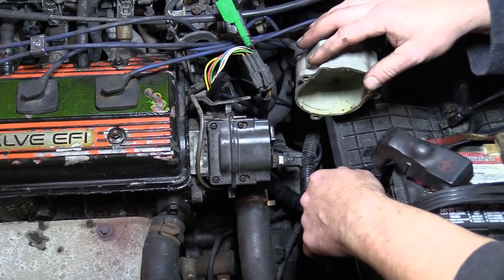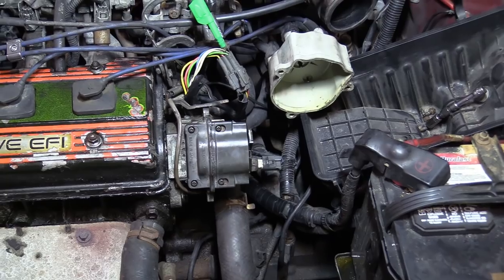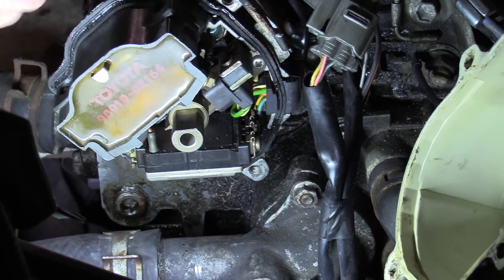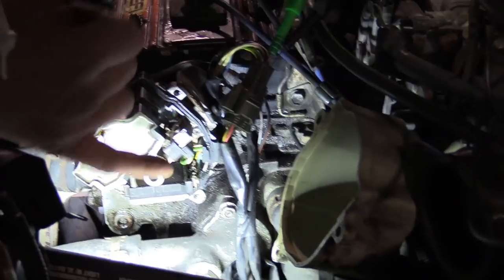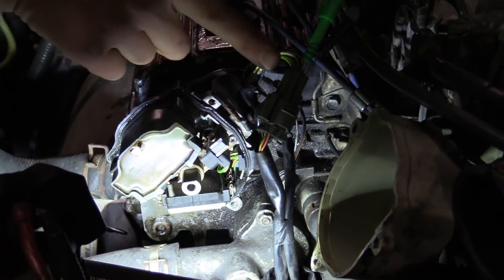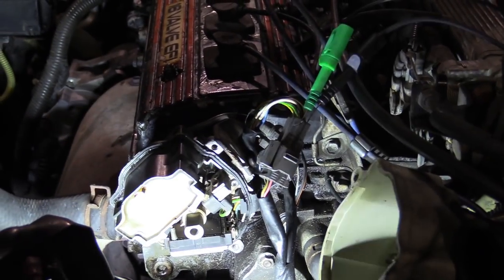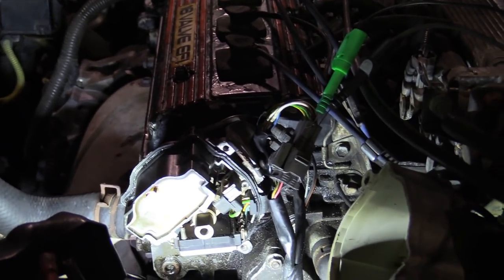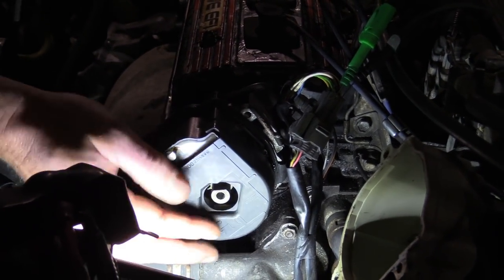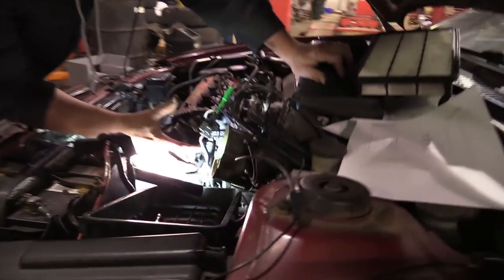It's very possible that the shield I left out could be contributing to that noise. The pickup that's giving me all the noise is this one right here — those two wires. My point is there's no other filtering I can do. If I can't make this code go away by putting this housing on and shielding that circuit, we're pretty much done — we're probably going to have to put a distributor in this. But you can see where that cover might be important for shielding. I did change a capacitor inside — you guys watched me do that — but that capacitor is wired to the positive side of the ignition coil. That could be the issue — that capacitor might just be junk, causing all this noise.